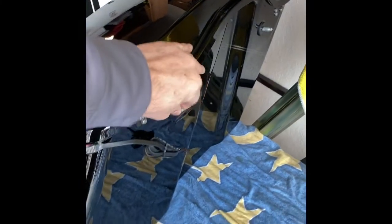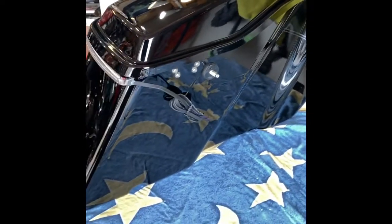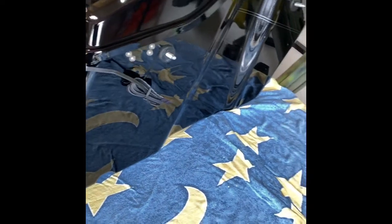So the saddlebag is closed and the light's on. I've got to place zip ties here, here, and here, leading up to the front of the saddlebag. I'll clean each one of those spots. Now, all those zip tie holders came in the plastic bag with the kit itself.